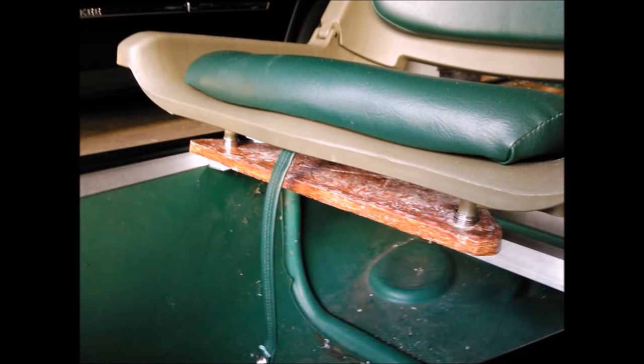Next, let's talk about the swivel seats. The reason I put the plywood there is for extra added support. There is a steel swivel bracket wedged between the wood and the aluminum bars. The screws run straight through the bars, up through the wood and into the seat. The swivel bracket only had four holes, but the seat had six holes for six screws, which left the two front screws without anything to mount to. When I sat in it, it leaned forward, applying extra burden on the back two screws. Eventually they probably would have cracked the seat, so I made sure it was nice and sturdy with that wood.